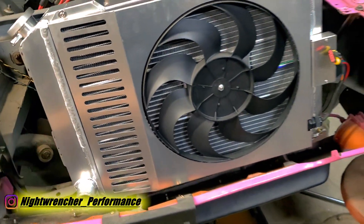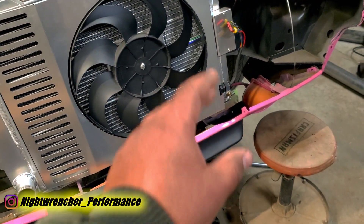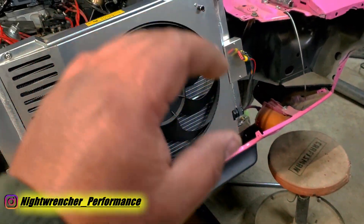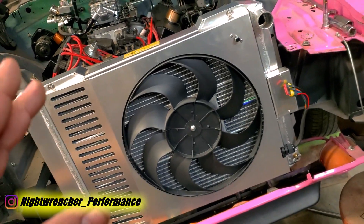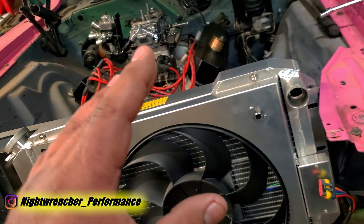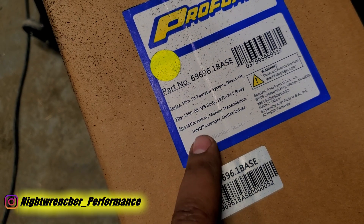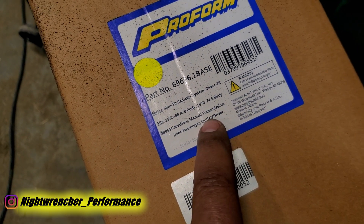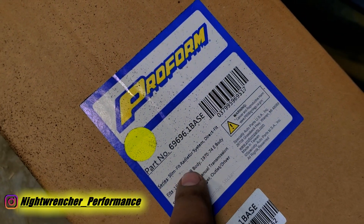Not all engines are like that. For example on LS engines they have the thermostat on the bottom so it feeds in from the bottom and then has the outlet on the top. Where that makes things difficult is if you're trying to source an aftermarket radiator for an application that does not necessarily belong to any single category — that's when you start to have problems. So where it says passenger side inlet and driver side outlet, that only applies to the car that it's listed as.